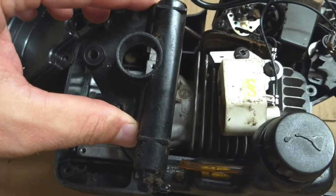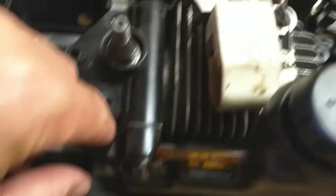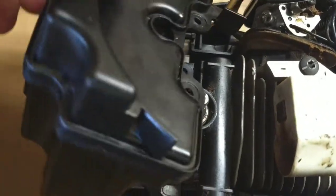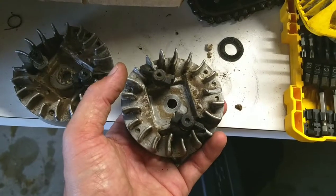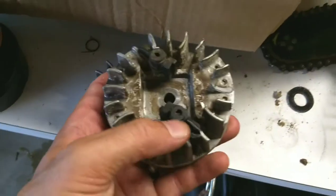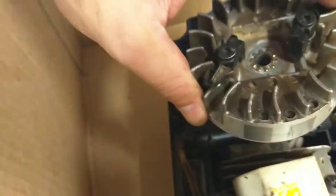Now that we've pulled our new oil pump, let's go ahead and set that back down on top, get everything nice and aligned, then attach the bottom oil line and the top oil line. Bring the cover back over and put the three bolts back in. I almost put the flywheel on but noticed one of these components was missing from the one getting fixed, so I pulled one off the old saw and slapped it on.